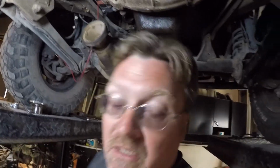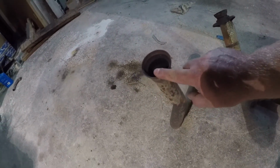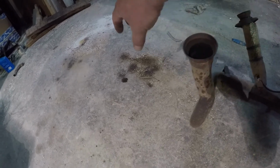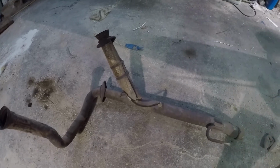Now what I've got down here is the factory Y pipe. Now this side I didn't change, so that should be fine all the way to the exhaust. Here is the side where I modified to the LA block style, so this is going to have to be over here. So what I'm going to do, I'm going to slice this thing right here, put a sleeve on it, rotate that pipe, then change out this end to match, and I think it'll all come together. But that side I'm just going to leave all as stock because that's the way it was. It did bolt right in.